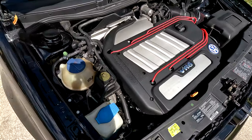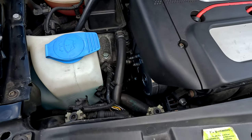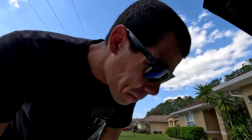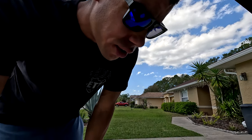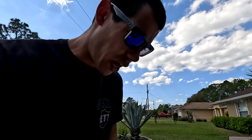Started the car and it's quieter, but I still hear something on this side. The water pump is new, the tensioner pulley is now new. When we turned the AC on and off it's not the AC clutch - the AC works fine. It's definitely much quieter now but there's still that rattle from this side.